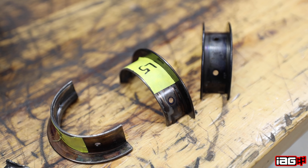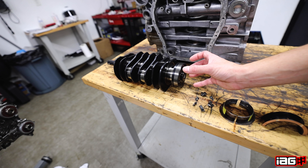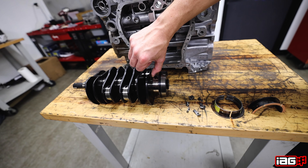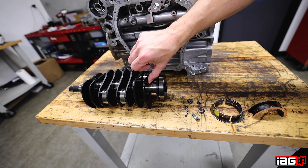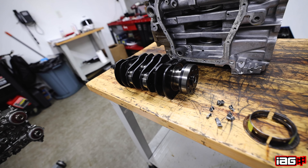In this example here, a pull style clutch where it's pulling back on the flywheel, causing all the pressure to be on the forward side of the thrust. As you can see, this one's been completely pushed into the crank, or the thrust side of the crank.